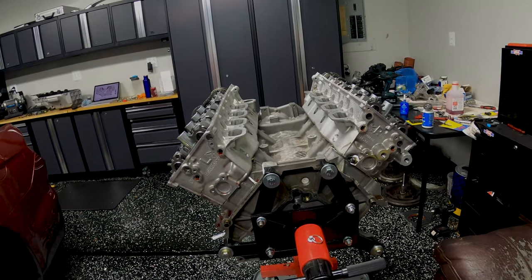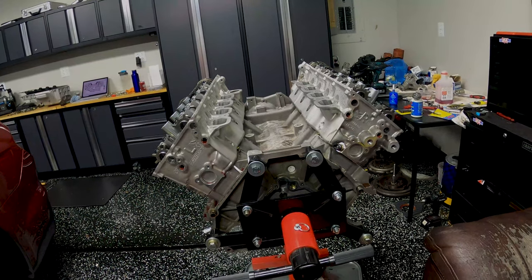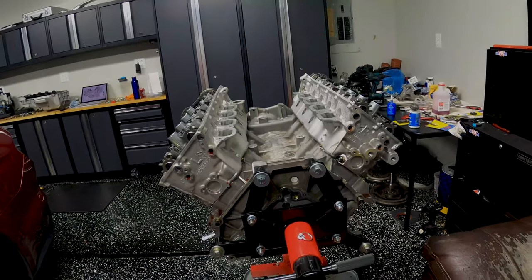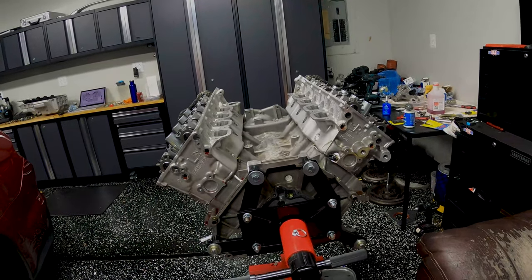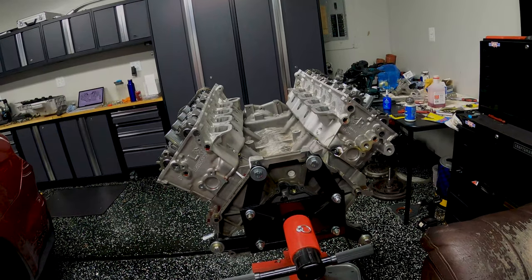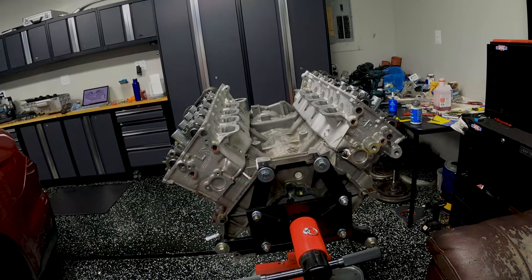If you're doing this inside the car it's going to obviously be a lot more difficult. From what I've read online you need to take the intake off, get as much access from the top as you can, and then you definitely need to remove the transmission and get that out of the way. Alternatively you could drop the whole K-member out with the engine and transmission on it.